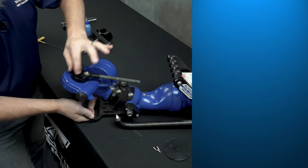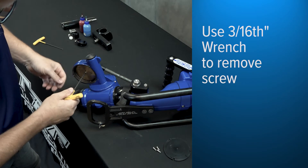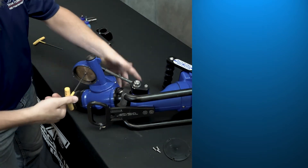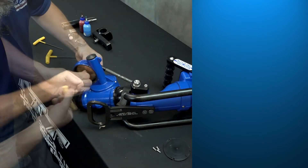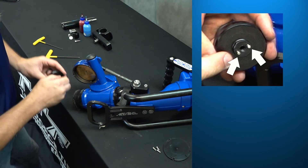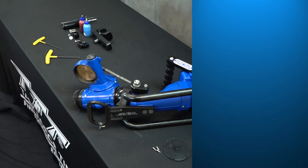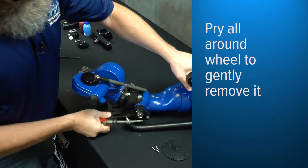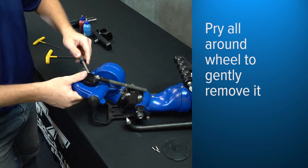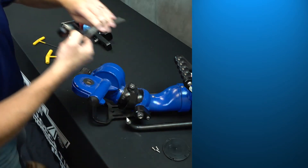Next, in order to get this oscillation wheel and shaft off, we are going to remove this screw on the bottom here using the 3/16 Allen wrench again. That's red Loctite so it will take a little bit of force, but the gear will have this all locked up so you don't have to put any opposite force on the other side to hold things in position. The wheel we are taking off has two pins pressed in that engage in this. You may have to pry that off if it doesn't just pull out. Using a straight-edge screwdriver, carefully pry between that wheel and the casting on opposite sides a little bit at a time so as not to cause it to jam up. Take that out and set it aside.